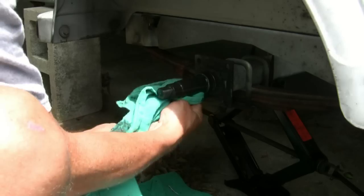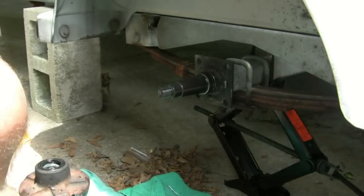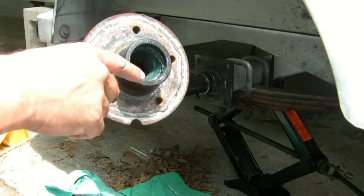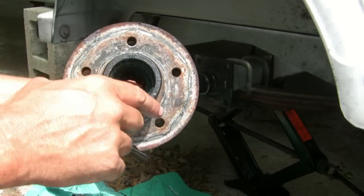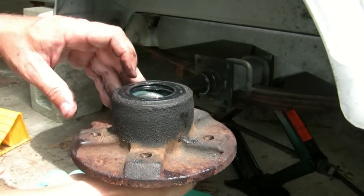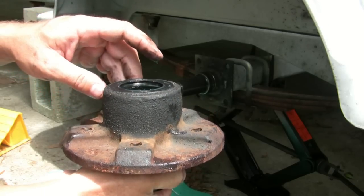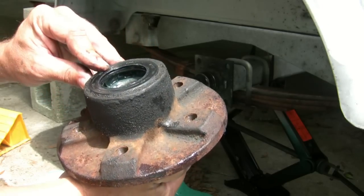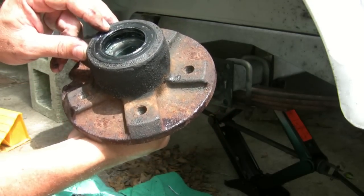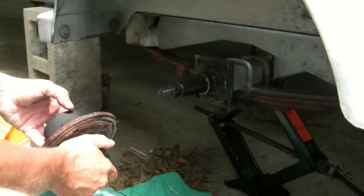So I've got the spindle all cleaned out. What I'm going to do is go in and clean this whole spindle up real nice and neat, clean out all the grease in here, and make sure my outer race and inner race are clean. I'm going to have to pull this seal off to get to the inner bearing, and replace the seal — the only way to get these seals off seems to be to destroy them. So I'll put a new seal on, clean it out, put some new grease in, and reinstall it on the spindle.